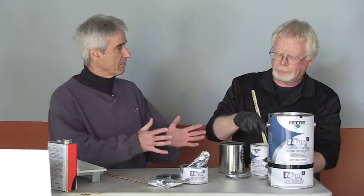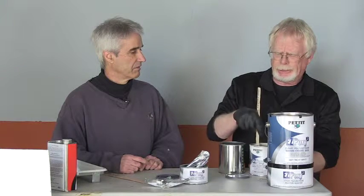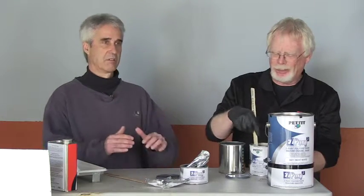Now, how much working time are we going to have once they're combined, Steve? Well, you've got probably 2 hours of pot life at a 70 degree temperature. A little bit longer pot life when the temperature's cooler because it catalyzes and sets up slower, and a little bit less time if it's real hot. If it's pushing that 85, 90 degree day, you may be better off picking a good day to paint, which is the second secret beyond just your prep. The two important things to any paint job are prepping for the paint to come on, and the second most important part is picking a good day to paint.